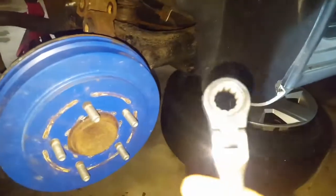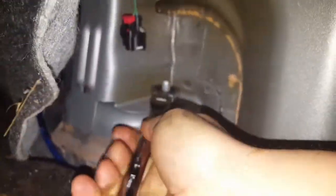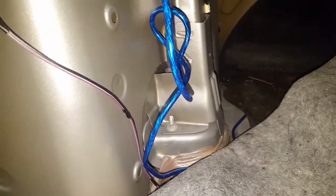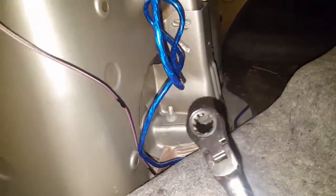So I'm going to go over the proper procedure. We're going to start with a 15mm ratcheting wrench and crawl into the car. I did the hard side first because I had a subwoofer in the way. This side is actually pretty easy to get to with nothing in the way. Some of you don't have air tools, so I wanted to show that you can start it with the ratcheting wrench — but I do have an air ratchet, so let's hook that up.